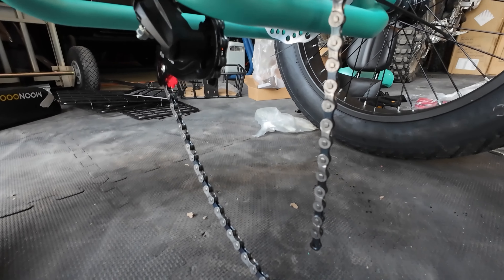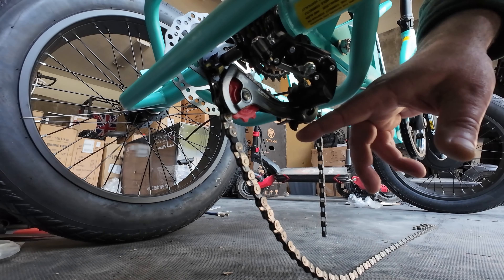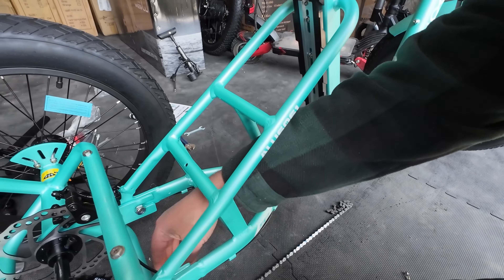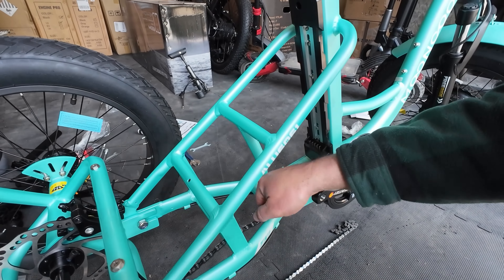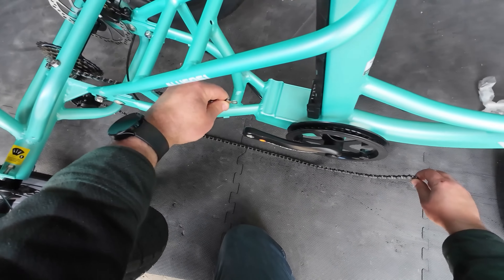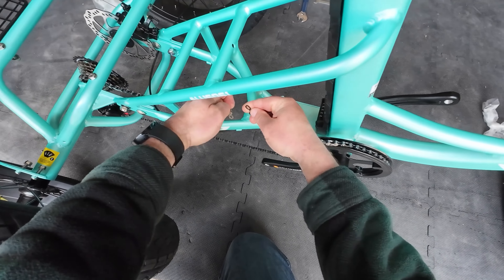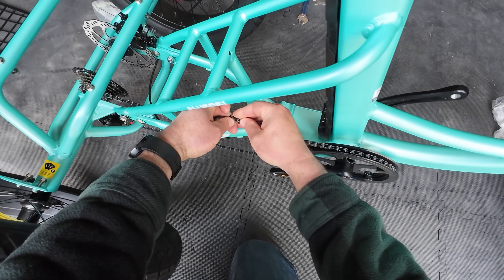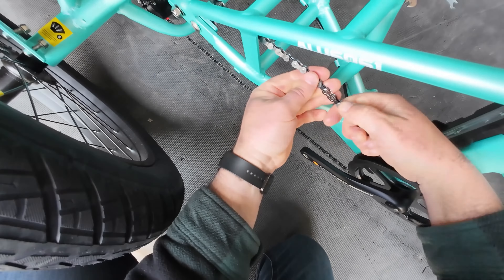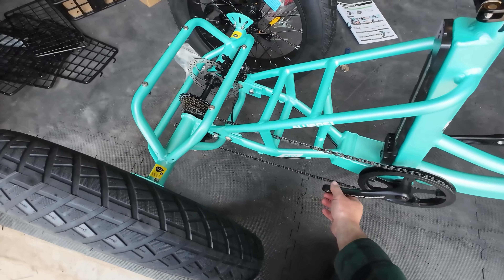It's a little difficult to put on the chain. You basically want to pass the chain up and over the red sprocket, then come down and around the darker one, go up and get onto the smallest gear, then come over through the frame. I've got my two little keys that came with the chain — put one in one end, pull the chain up and around, then put the other end in the opposite side and link them both together. You'll feel it snap in, and that's the chain on and freewheeling.